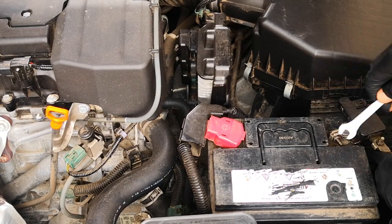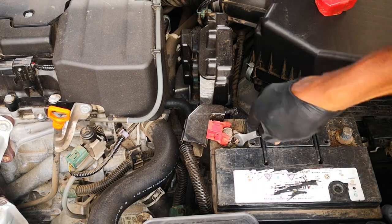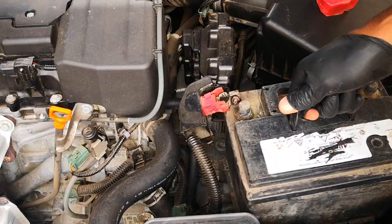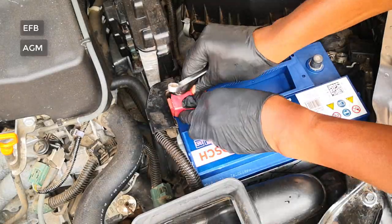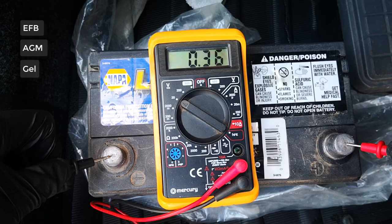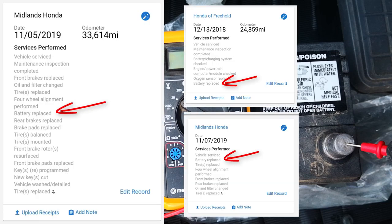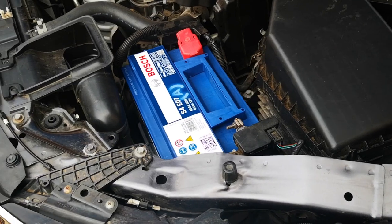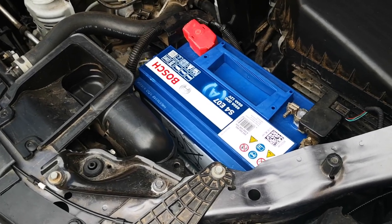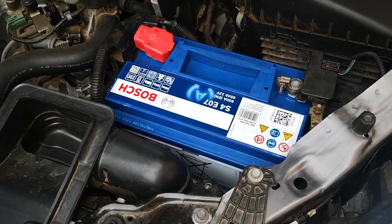In summary, the key takeaways from this video are: get the freshest battery possible — it's not enough to just buy a new battery. Testing and charging it when necessary before fitting it into the car is essential. Certain battery types are better built to last longer, although they may be pricier. If you've had many mishaps with other battery types and you can afford it, you could explore one of these. From the service record of my car before purchase, the previous owner had replaced a couple of batteries in a short space of time. I'll document my journey with the Bosch and see what comes. Lastly, even if you stay with regular wet cell batteries, preventive maintenance can get more out of your battery. Let me know what you think in the comments — like, share, subscribe. Cheers.